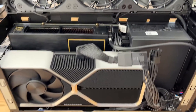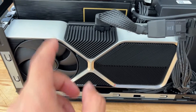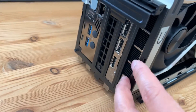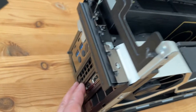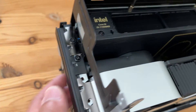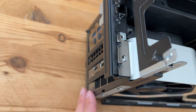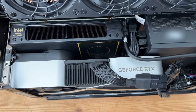I've peeled it open again just to get a sense of airflow. Air is drawn in by two fans, one on either side of the card. For one fan, air is drawn in and expelled immediately to the rear exhaust, which could be problematic because the hot air gets pumped up there, and the NUC unit itself draws fresh cold air there — so hot air gets pumped out and hopefully doesn't get redrawn back to the CPU unit in the box, which would be quite problematic.